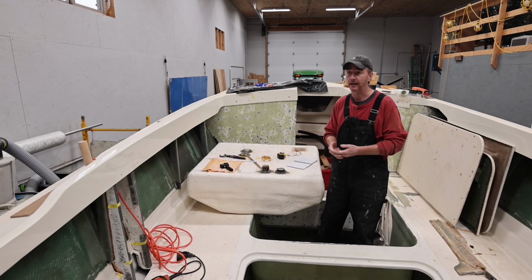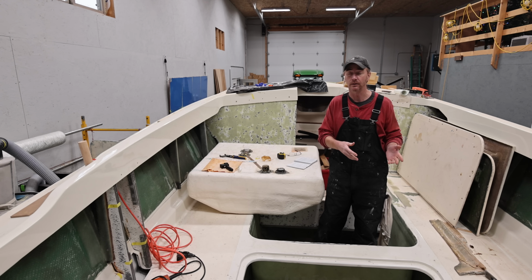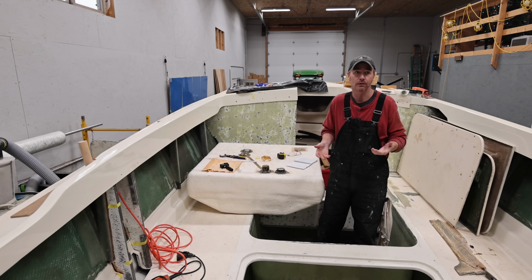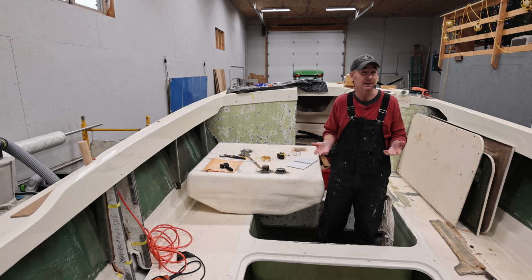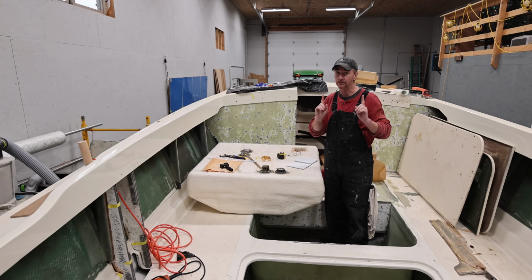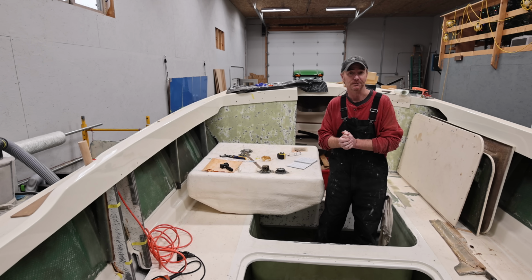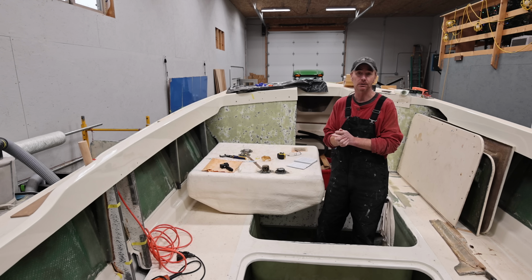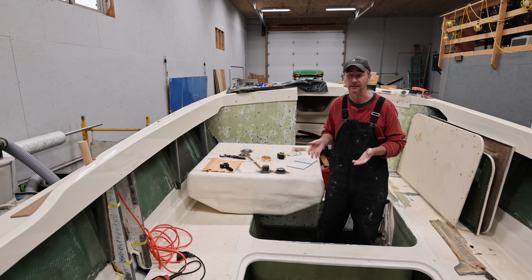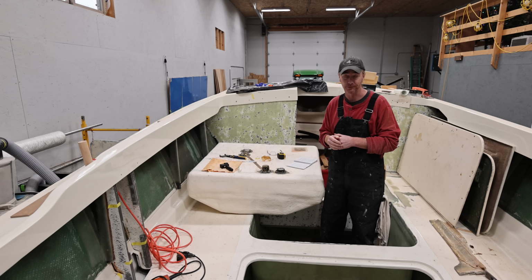Right? It is a big one. I don't know exactly what a new tank would cost if I were to go with a different type of material like aluminum, but I wouldn't be surprised if it was somewhere around $1,500, maybe even $2,000, give or take. So that's a pretty big pro, but it's only one. Now, as far as the cons, there's quite a few. I guess the elephant in the room is that this is a fiberglass tank that has been built with resin. Now the sticker on here says that it is ethanol resistant, not ethanol proof.